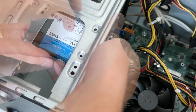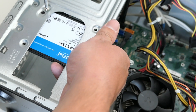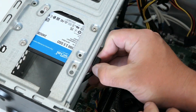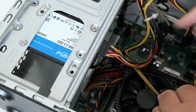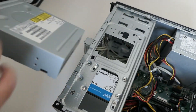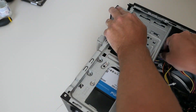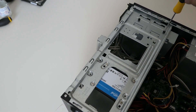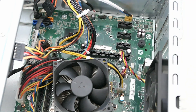It's time to fix the new SSD. Pretty handy that this case already has the correct mounting holes for a 2.5 inch drive. Then we can connect the other end of that SATA cable and provide power to the drive. Next device is the DVD drive, which we can slide in from the front, then connect it to SATA and power as well, and fix it with two screws. Last thing to connect is the case fan, which goes in the brown connector on the motherboard. And we're ready to close up the case.